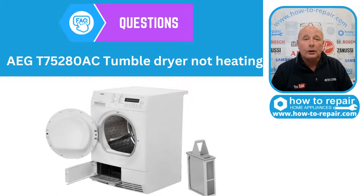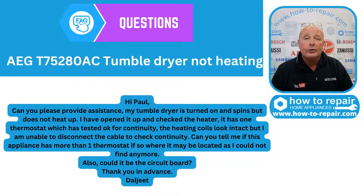This is made by the Electrolux Group, and they're very good towards engineers giving us the correct information to be able to diagnose problems. The workshop manual, which I'll bring up now, is able to clarify the heating size, the NTC sensors, and the values that you need to be able to repair this machine.